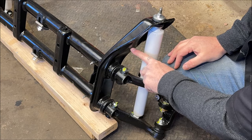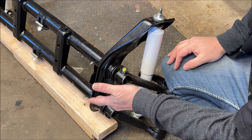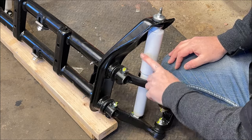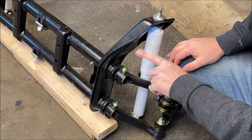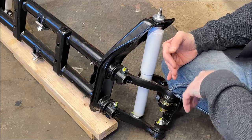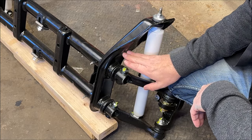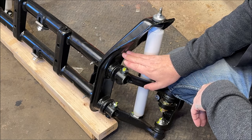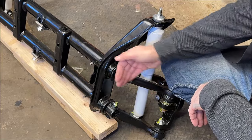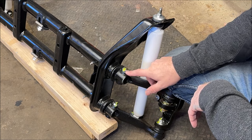But if we're going here, when you go to grease the fittings for your chassis lubrication every oil change, it'll be easy to cut your wheel, say for this side to the left, and come right in and hit that grease fitting. You're probably not going to have to grease this very often, but it can't hurt because once we fill this with grease, it's going to keep that rust from forming inside. Hopefully, but it should.